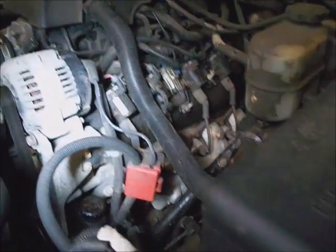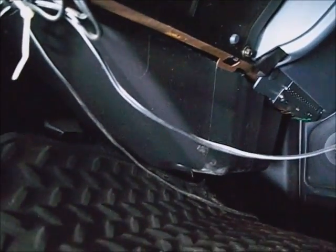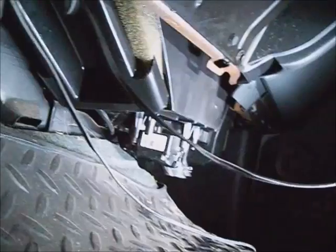The next step is to take the covers off the lower heat box. There appears to be something in the middle — a temperature control actuator is underneath there. I'll check if it's moving like it's supposed to be. The lower cover is now off.